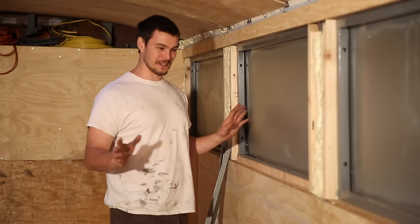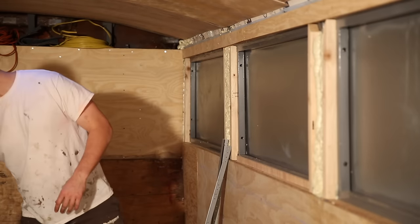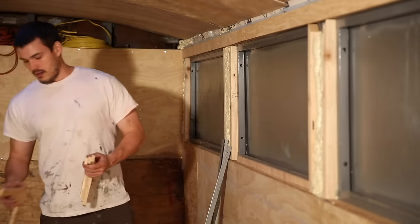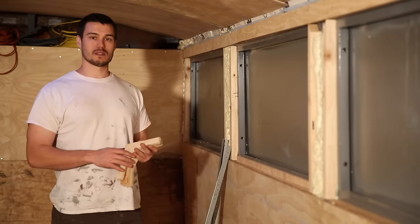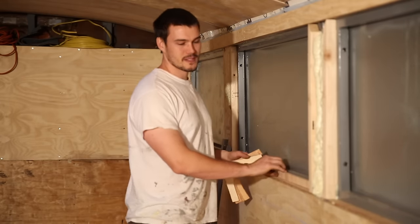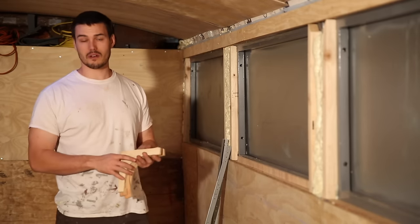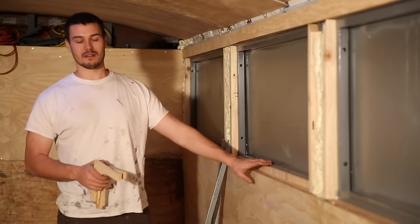We have a certain radius around the window. The windows are oval, so there's a radius on the corners. The clamp ring needs to have continuous contact all the way around, and because I just ripped out rectangles, it left the whole corner open — there wasn't anything for the clamp ring to grab onto. Unfortunately, it took me installing a set of these to realize that mistake.